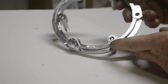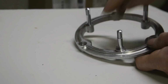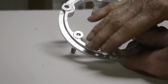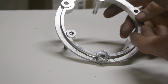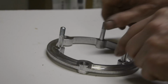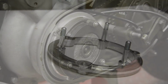Then on this side we have the same thing. This sticks up a little bit more on the 1/16. I've measured the recess and all that. We're going to have plenty of meat if I just mill that flat on that side and mill that flat on that side, and we're going to have 5 30-seconds instead of 6 30-seconds. So let me just screw these out and go and set this up on the mill and just whip those off, and then we'll see how it fits.